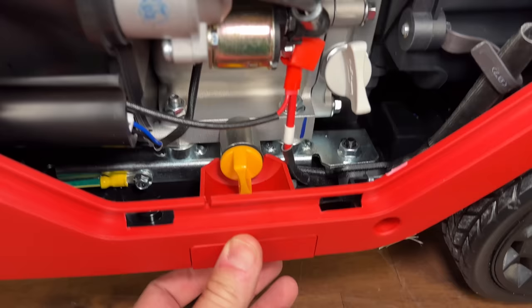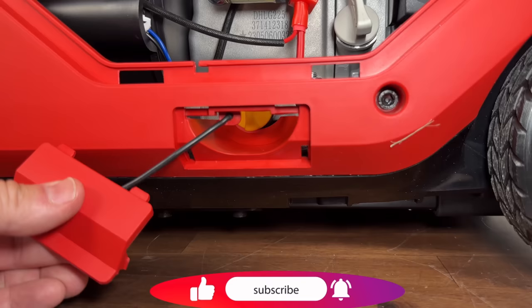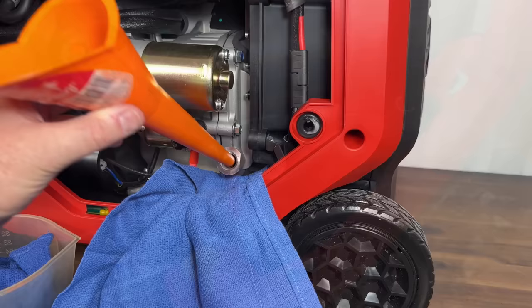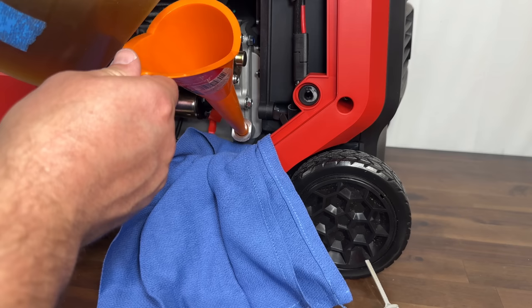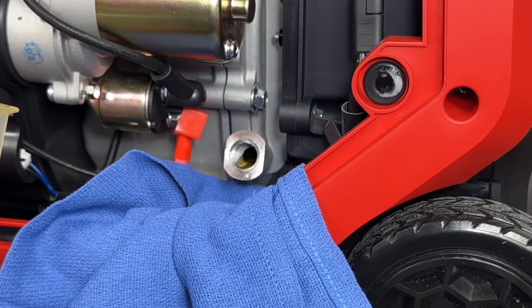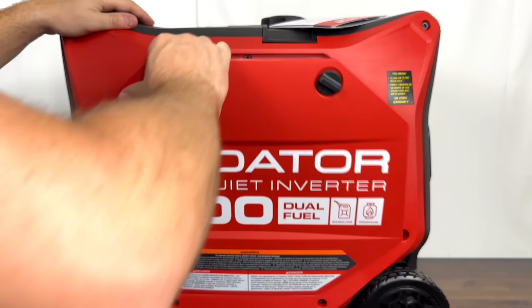They included a little spillway for the oil, so you just put a pan underneath, open the oil plug, and let it drain — not a bad idea, but a drain tube might have been nicer. Before adding oil, take note of how much might already be in it so you don't overfill. This takes about 20 ounces of 10W30. Don't pour it in fast or you can easily make a mess — pour in a little bit at a time.